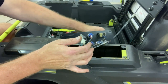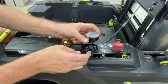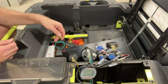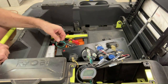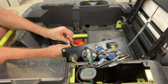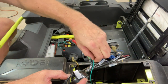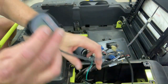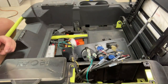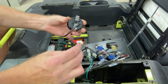The next step is to turn the key off and button up the rest of the stuff, then work on the panel to get the new gauge mounted. I did a few things to tidy up: the green wire I added goes from the voltmeter attachment, the battery life attachment. I ran that in here and put in a connector so that if this battery pack ever has to be slid out, it can be unplugged. I ran the green wire up and connected it to the green wire on the existing gauge, which measures 48 volts when the key is on. Then I ran the wire for the new meter underneath here as well, popping it out so it's ready. We'll tidy this up with some zip ties.